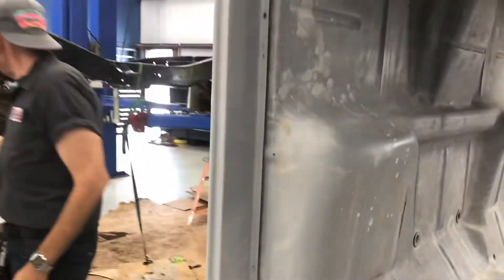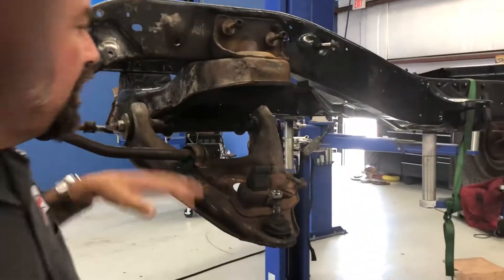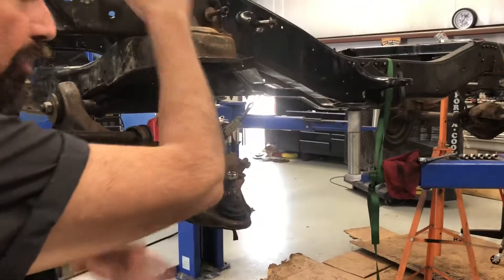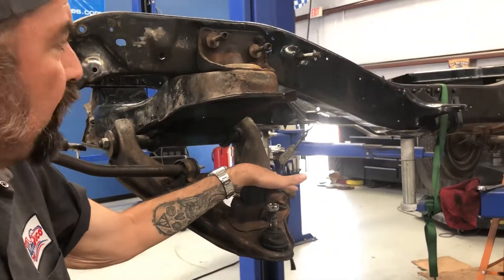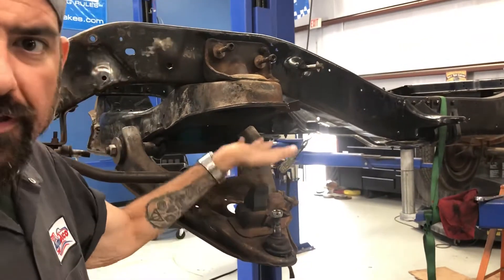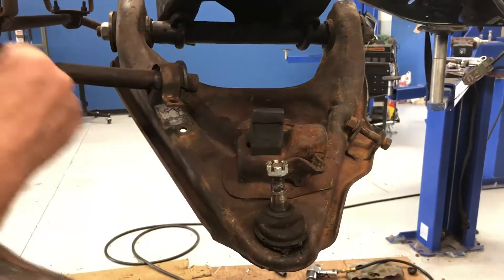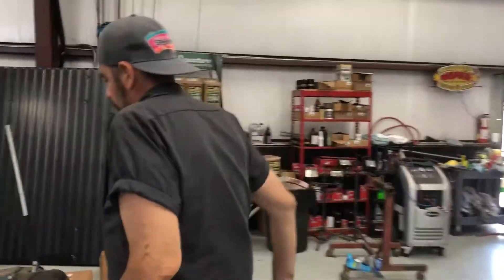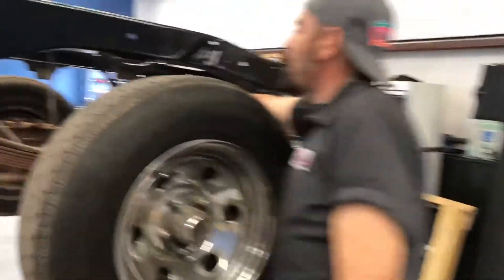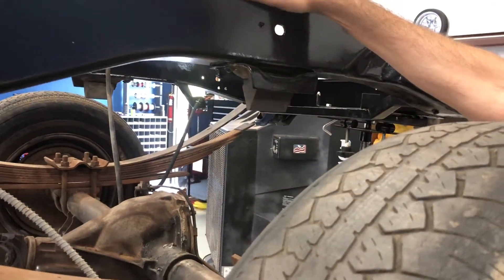Over here on the frame, we're doing a little bit of rehab. Got a couple of areas we're cleaning up. These are the upper and lower control arms — we're replacing the ball joints and the rubber bumpers that make sure the frame and control arms don't smash against themselves with metal on metal. These bumpers are in the front, and there are some in the back that keep your axle from slamming into the frame.